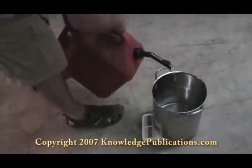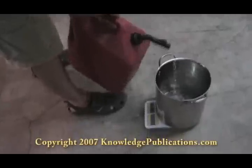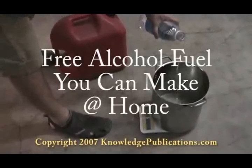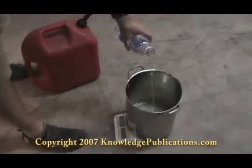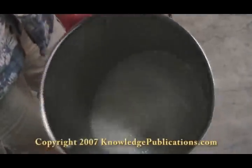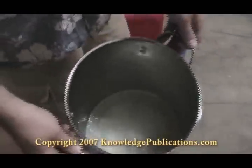What we did is, for an experiment, we took 250 grams of straight gasoline — this is pure gasoline from the pump — and then, to that amount of gasoline, we mixed in an equal amount of the alcohol that we had distilled. As you can see, it's not fully mixed, but it is about to be. You swirl it around like this and it becomes very homogenous. That is a 50-50 mixture, by weight not by volume, of alcohol and gasoline. The alcohol is only 92% alcohol; the rest is water, which is okay for most vehicles and engines. It does not have to be anhydrous.